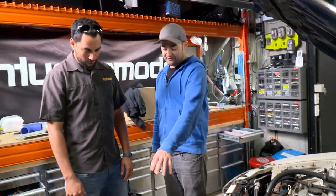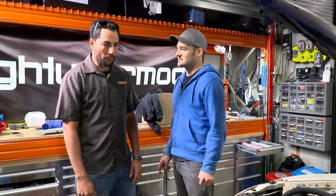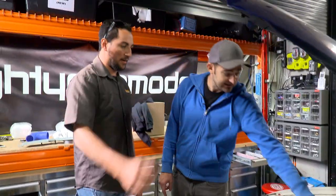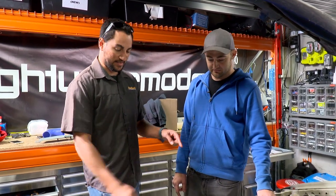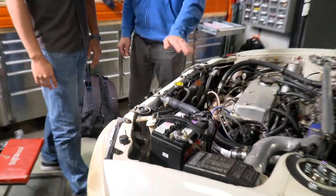I'm going to keep an eye on this — I'll put some temp sensors and see how it goes because it may be too small. We can put an air temp sensor up before the throttle body to get a true inlet reading using an open tip sensor. We could also put one on the hot side as an EGT to watch how efficient the cooler is, and see the temperature differences as it gets moving around the track. I'm also going to get rid of the air con condenser so there's less stuff in the way.